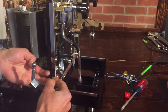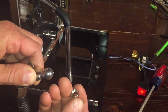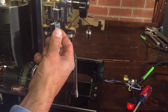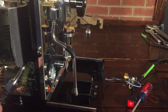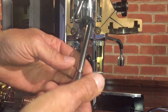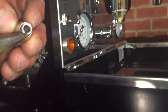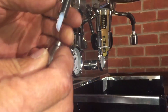Your steam wand — you have a spring up there and a piece that goes on top so it rolls real nice, and you just push up and screw it in. If you ever want to take these off for cleaning, you have to push pretty hard because of that spring. It's a no-burn steam wand, but they put rubber on it anyway. The steam actually comes through the Teflon — that's how it's insulated — and there's another little O-ring inside that seals against the Teflon.